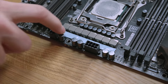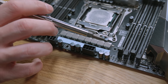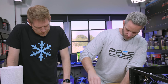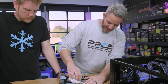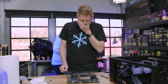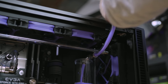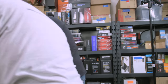I can't remember if I did this right on my D-frame or not. All of that for that. Now we have to redo the thermal paste. These are the VRMs down here — we had stuck the pad on the choke. I think the reason I did that out of habit was because on the GPU blocks, you do cool the chokes too. We could have done all this off camera and not showed anybody, but we air my mistakes around here. We like keeping it real. This is how people learn — if the guy is always like, I'm perfect and I do everything right, then no one learns anything, because a real person is going to make that mistake. But if they see this and think, well, this pro makes mistakes too — then it feels more real.